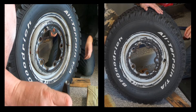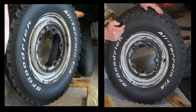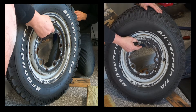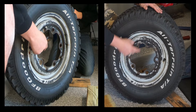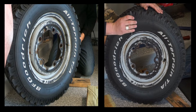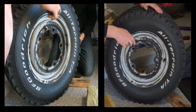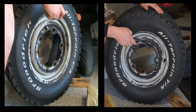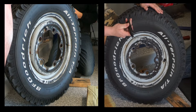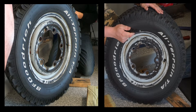The clips go in nice and easy. If your clips are just broken, you've got to grind off the head and beat that little pin out from the back to get the old clip off. The new clips you can get from Wolfsburg West — I'll put the link in the notes below. This tool, you can get one and make your friends pay for it and say you're going to share it.